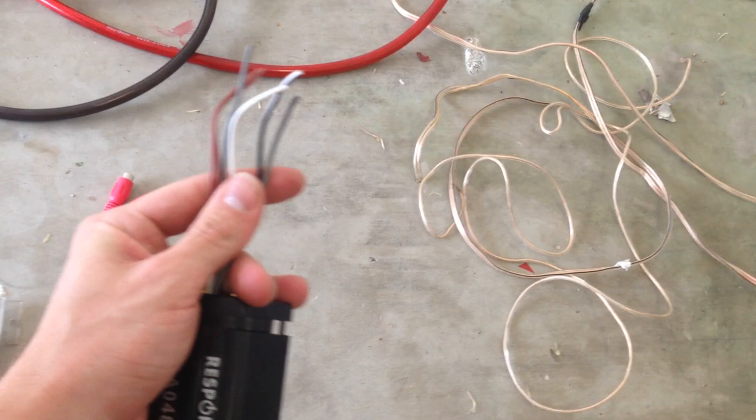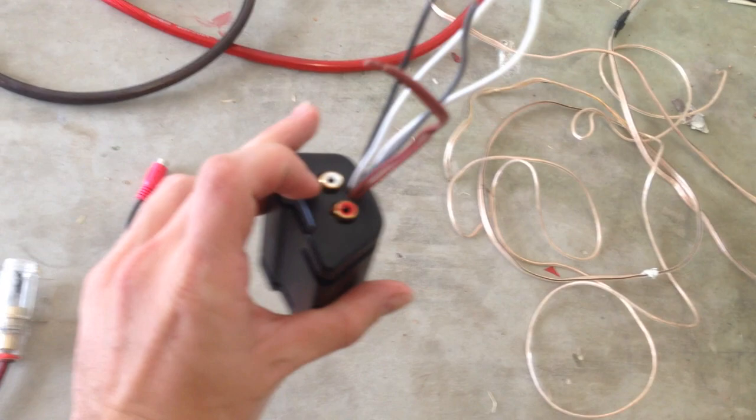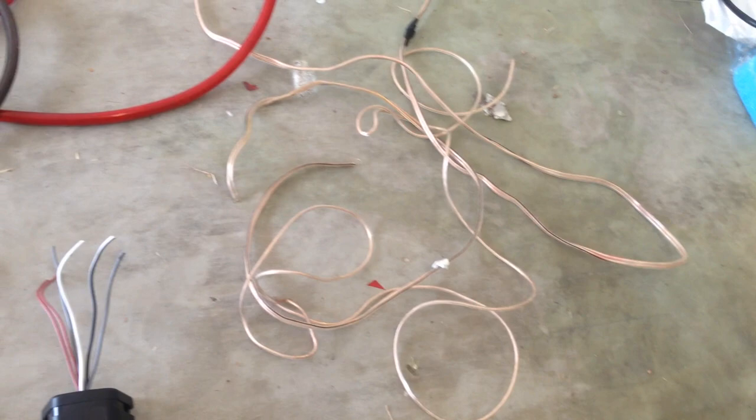This is your line converter. What it does is take the signal from the wires normally running from your head unit to your speakers and changes that signal into RCA, which can then be plugged into your amplifiers. The amplifiers then amplify your signal, and you use speaker wire to run that signal back to your speakers — and you've now got higher quality, nice loud audio.